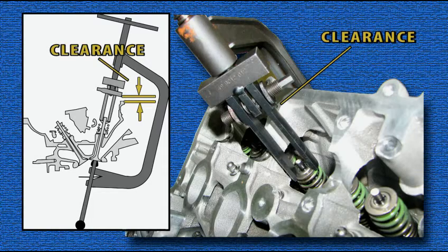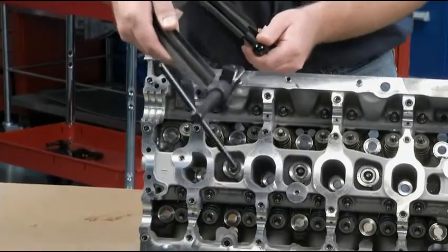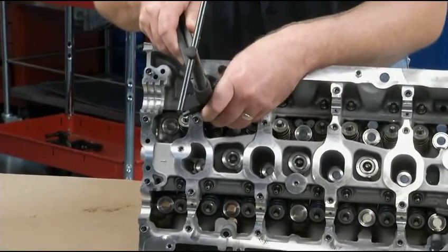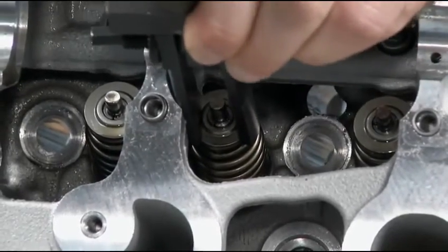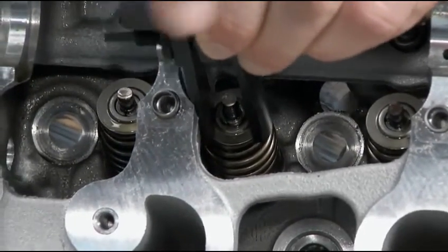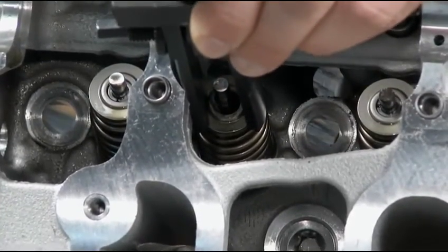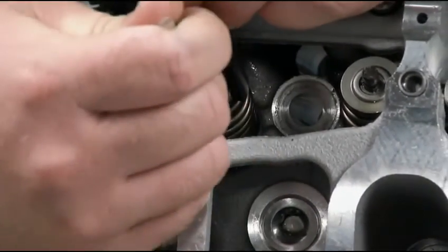Also, the thickness is reduced at the tip from 2mm to 1mm to make it easier to set the new tool feet on the valve upper seat. Use the new special service tool to avoid interference during valve spring compression. Use of the new tool is the same as before, and you are still required to use the same valve spring lifter arm as before.